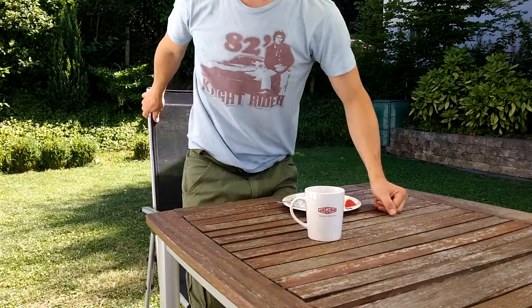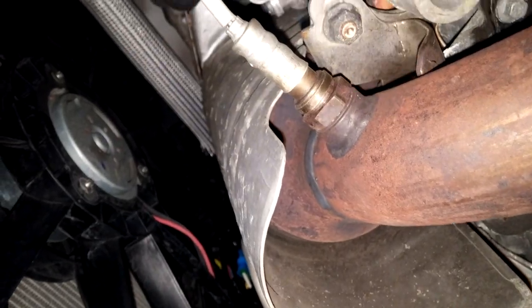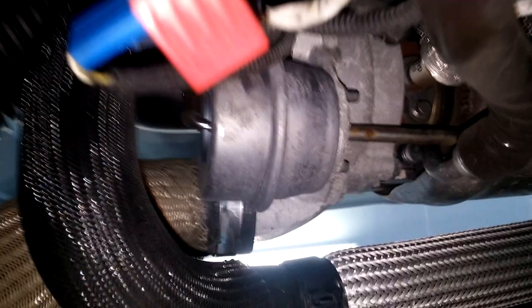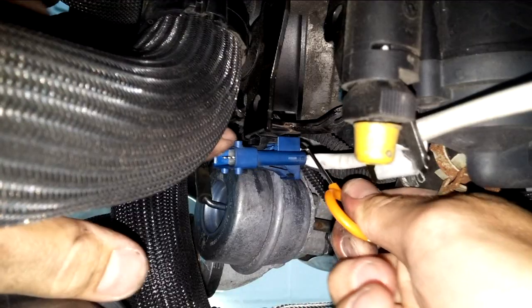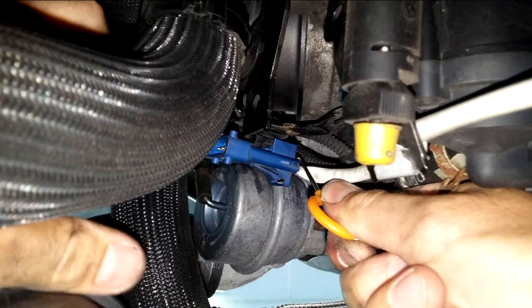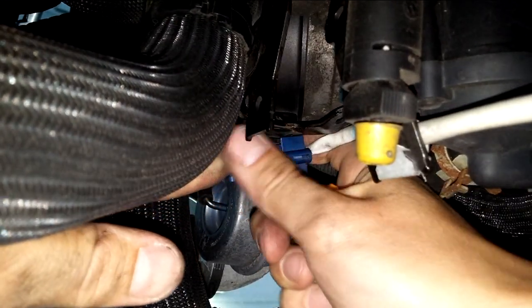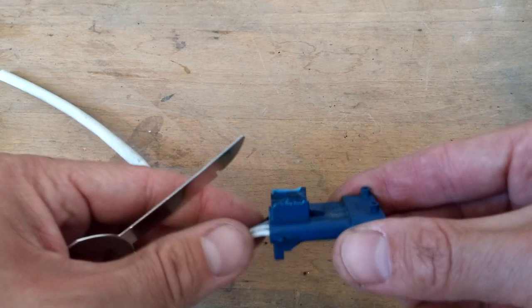Right, back to work. Let's go under the car. This is where the sensor is screwed into the exhaust and that's where the connector is plugged in with the CPU. Lift the red top and unplug the connector simultaneously. Now simply unclip the blue connector from its bracket. What seemed to be the easy part ended up being a total pain — pushing and pulling from below and from the opposite side by hand and with pliers, it just wouldn't come off. Ultimately I got it released with the help of a flat, very thin clip. The plastic came off, but I'm replacing it anyway, so no worries.